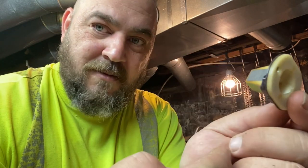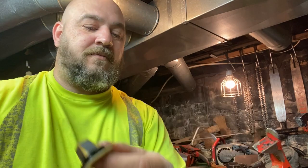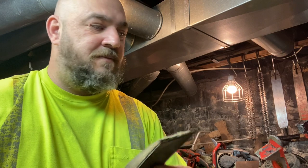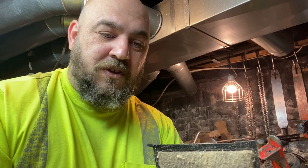A piece of wood chip made it through the airbox, through the carburetor, and got wedged in the reed. Now, consider this: here's my air filter — it doesn't look very good. It's got plenty of sawdust buildup in it. Sometimes I've cleaned them and they work fine, but consider replacing it — it's an inexpensive part. You really know when your air filter is bad if you're tuning the carburetor with the air filter off and then put everything back together and your tuning changes noticeably — it's typically because your air filter might need changed. There might be enough sawdust buildup that it's giving you just enough restriction that you need to change your air filter.